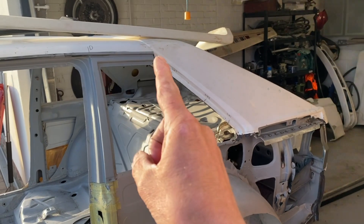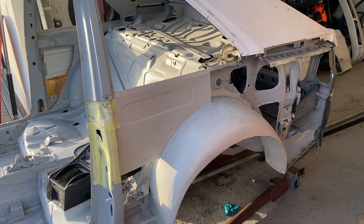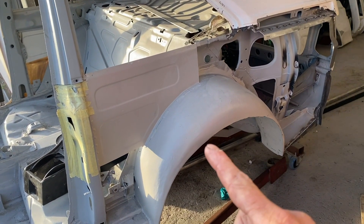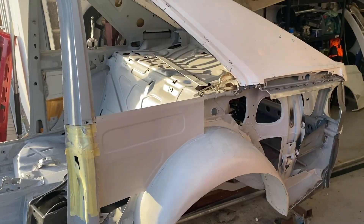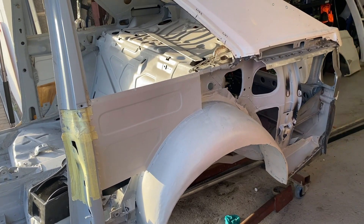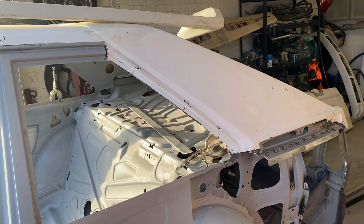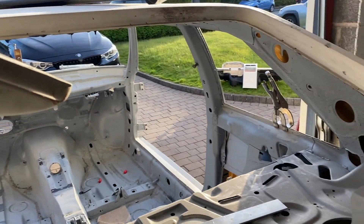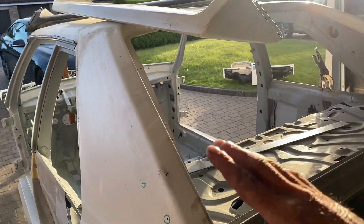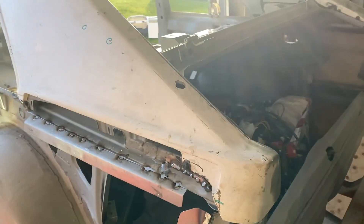This is the area where a lot of work is done - you cut your section out, take your 320mm out, and pull the car back in to make the small window. Obviously when you cut it out there are no wheel arch tubs, so these have had to be made and everything has had to be shortened. He's put full steel sills in. There is a lot of metalwork in this car. I also found out this area is supposed to be a lot thicker, and this slope here is slightly different - more pivoted up. I don't think I'm going to replicate that on mine.